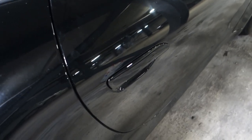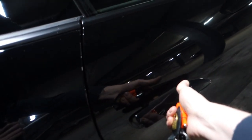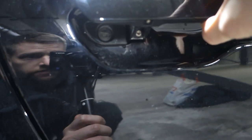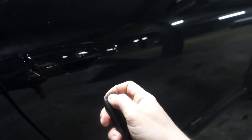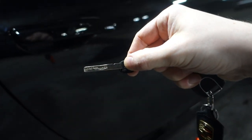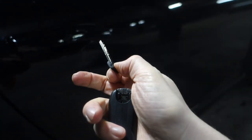You can see with the car locked, the door handle is flush and it's down. If we go to try and lift it up, you can pull it to two clicks and the door stays locked. Now underneath the actual handle is the locking mechanism — there it is. Now with your key, you have on the back a bit that slides out. I've unlocked it already so I can get it out because it's very tight. If you need to get it out yourself, be careful, but it is a push fit and it just comes out the back like that.